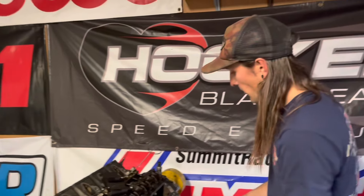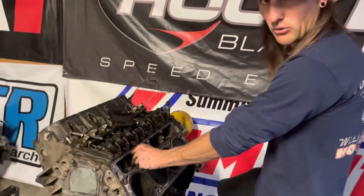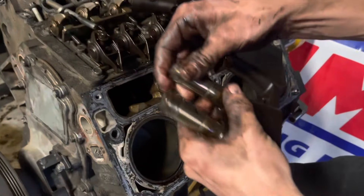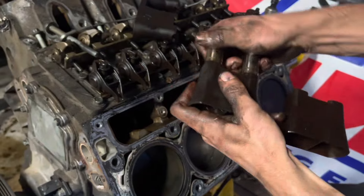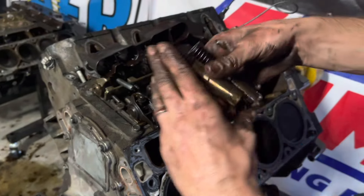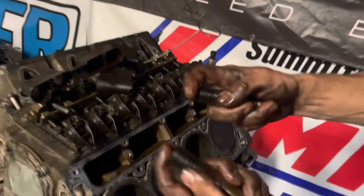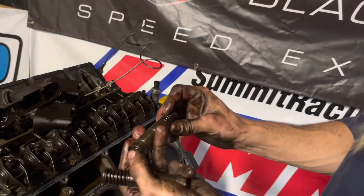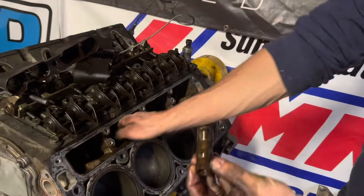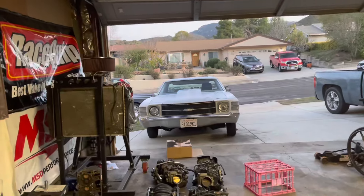Let's get the rest of them out, see if there are any more failed ones, and then this thing will be ready to sit and hopefully get built and put into something. These trays are in pretty good shape — they're actually coming out as they're supposed to. Here's a non-collapsed one versus the collapsed one. You'd never reuse them in a million years, but they're not as bad as some we've seen. Hydraulic lifters already have a lot of moving parts — let alone adding even more moving parts. Keep your lifters simple, kids.